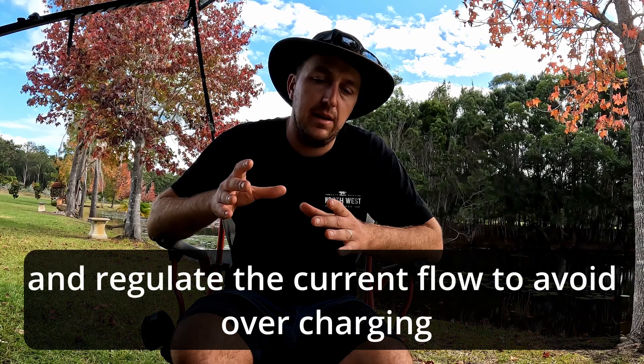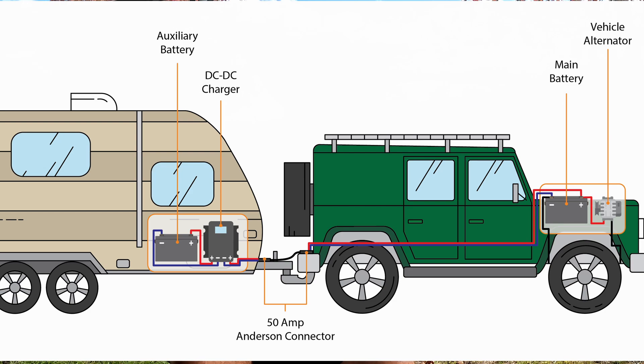That's one way of charging your batteries — through solar panels through a regulator, which drops it down to 12 volts, because typically solar panels provide 18 to 24, sometimes 36 volts. Another way of charging is if you are connected to shore power — your battery management system will use that 240 volts to charge your 12 volt battery. The other option is while you're driving you can have a DC-to-DC charger running off your alternator, providing around 14 to 14.5 volts to charge the batteries. A lot of modern battery management systems can blend solar and alternator input together, so you can really charge up those batteries nicely on a driving day.